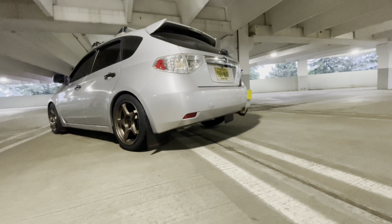And the tires are Nitto NT555 G2s. They are a 225/45/17, front and back. It's not a staggered setup. It's an all-wheel drive car. But yeah, you're gonna need hub centric rings, which are 56.1 or 56.3 by 71.3. It will be different for a different wheel, but the hub bore on the Subarus is a 56.1 or a 56.3.